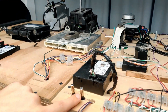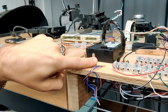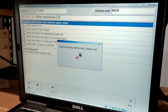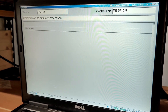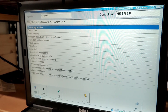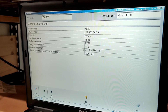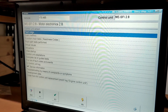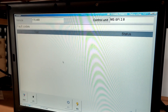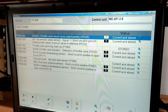Now we have to turn the ignition. We take the key that's already inside the ignition switch. Since this is not a real Mercedes, we make it similar — you turn the ignition on and it automatically reads the data. It's a good sign — it means we have communication with the engine control module. The ECM communicates just fine. Going into 'Control Unit Version,' it reads the data: ME2.8, part number Bosch, everything. The engine control module has no problems. Reading fault codes, we expect to see a couple because not everything is connected on the bench — some codes will be active, some stored.